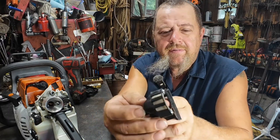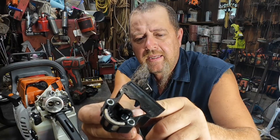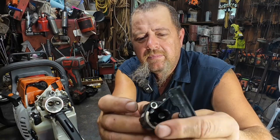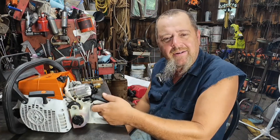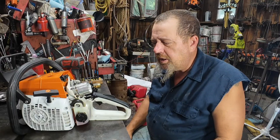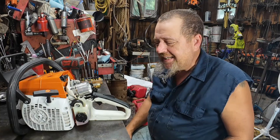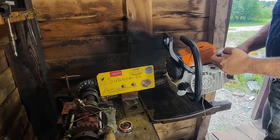You can see that's pretty restrictive. Even on a stock saw, this could be ground back — you could open this up and get some more air in there, but that's not what we're doing. We're testing the velocity stack horsepower gain. What do you think? We were at 4.61 horsepower on this the way it was, with this muffler mod. What do you think we're going to get? Let's go get her on the dyno and find out. Ruth with velocity stack, just warmed up, run one.